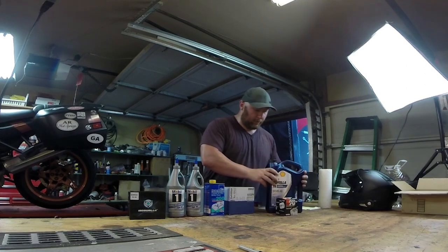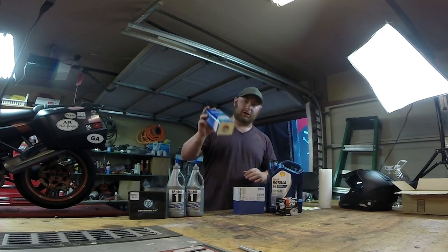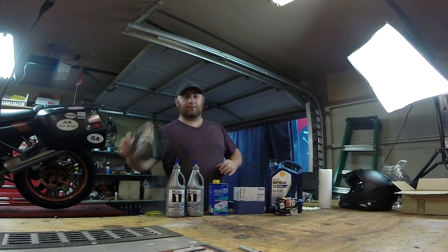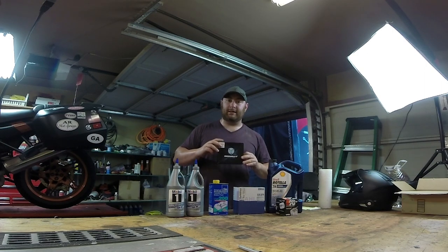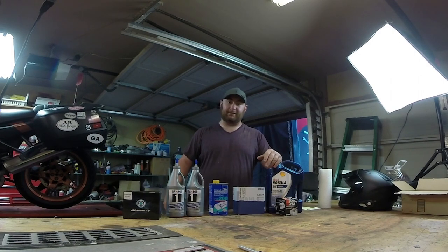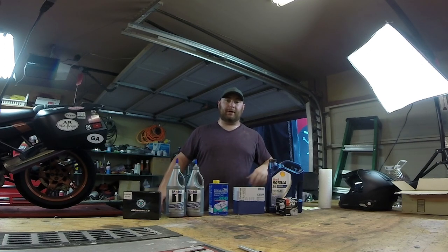So what does that mean? I'm going to show you guys how to do an oil change, we're going to replace the air filter, flush all the brakes, replace the transmission fluid and the final drive fluid, and we're going to see if we can put in some H4 LED headlights to give it a little better shine because it's running stock factory bulbs and they're really not that bright. The bike's in really good condition — it's got 48,000 miles on it, been well maintained, so hopefully this should be pretty trouble-free.